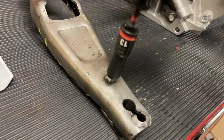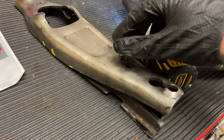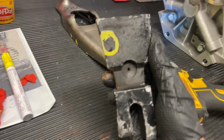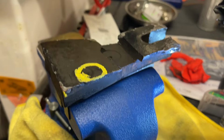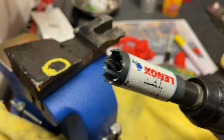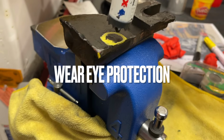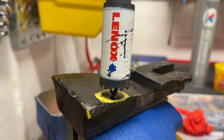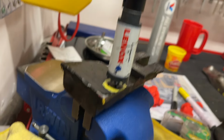Okay, 13mm socket here. Okay, and we're just gonna take this off, and we're gonna drill it out right there. Okay, so this is what we kind of want to drill out. This is a hole saw, so it has a drill bit in the end of it to help pilot it. And then it's gonna basically drill down in a circle. So if you want to see more on how that works, I'll put a video in the description where you can get these, but we're gonna go ahead.